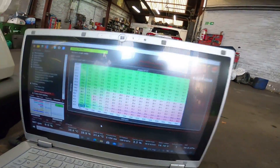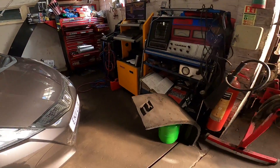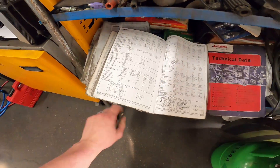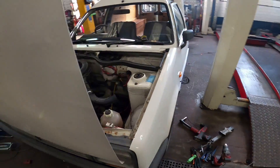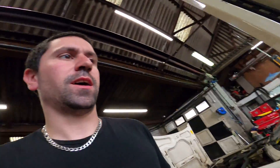I've put a Z-Tech turbo base ignition map on here — it runs on vacuum so I haven't got throttle position. I cheated a little bit and looked in my old Autodata book for the base timings for the Renault 5, got a rough idea of base timing, then added some timing higher up the rev range. Probably dead on its limits when I go up the road but never mind — listen how nicely it runs! Can't wait to get rid of that carburettor. I did accidentally trigger the hall sensor with a 12-volt feed instead of 5 volts when I was trying to get it to fire, and it backfired so loud it actually blew a hole in my exhaust.